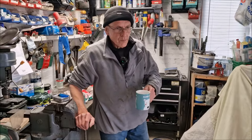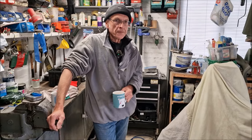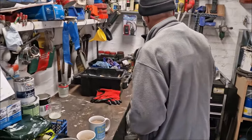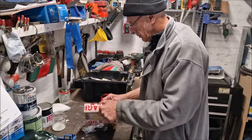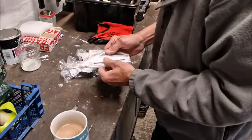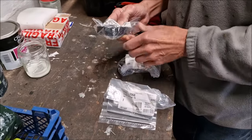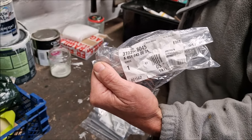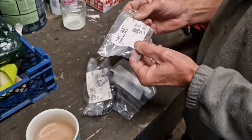So when we were putting the car back together, as we've just seen in the clip in the introduction, you said that's broken - the pins. And I've gone, no, it's meant to be like that. And as always, you were right. I've been on eBay and I've bought a kit. Let's have a look at the parts. So we've got a couple of pins - bits of metal there and there. And the hinges themselves. The part numbers: it's A4517430051 for the hinge - you need two of them. And it's A0009916415 for the pins if you want to do this job yourself.